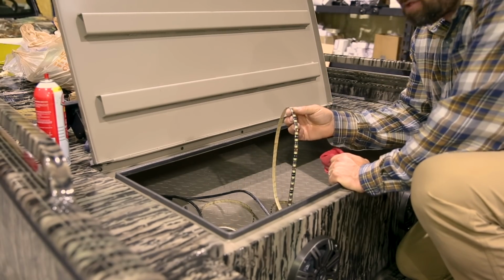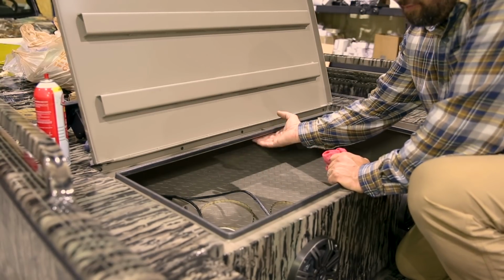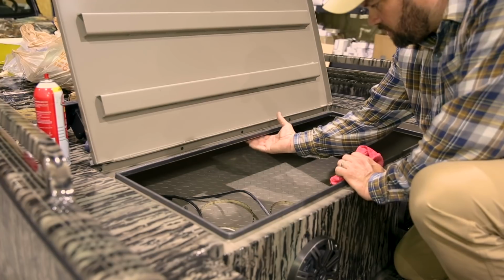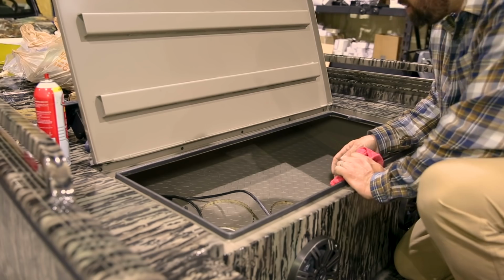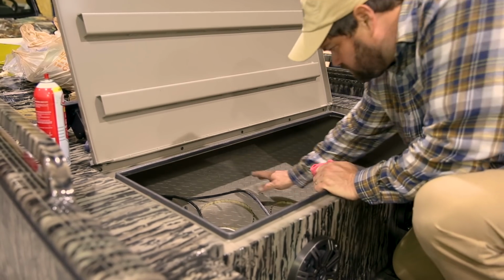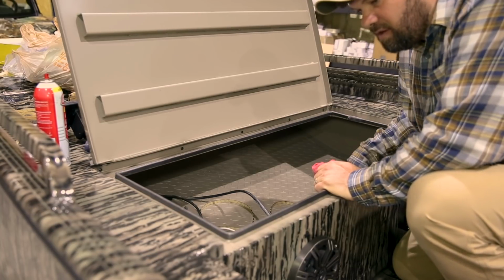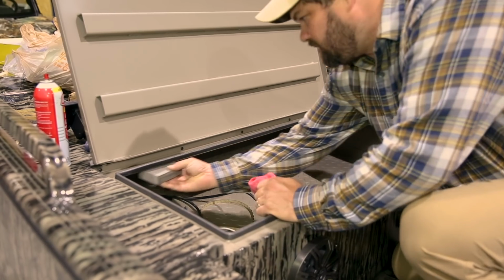Next, we're going to install this white strip light in this edge front hatch. We're going to install two in here. We'll install one under this lip and one back under here under this lip. Reason being is this edge boat goes way back up in here. You have so much storage in here, it's ridiculous. If there's not enough storage in here, you're carrying too much stuff. So we're going to sand up under here.